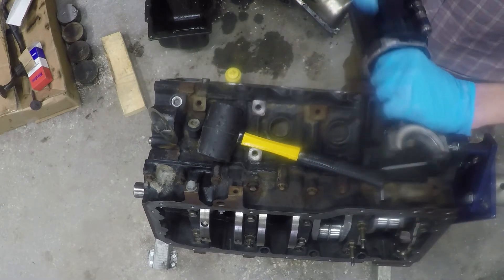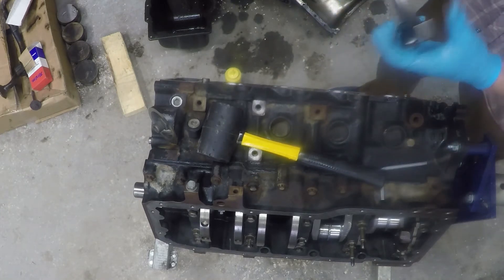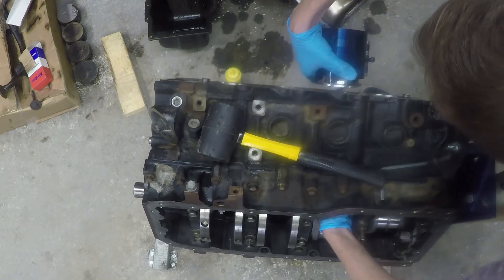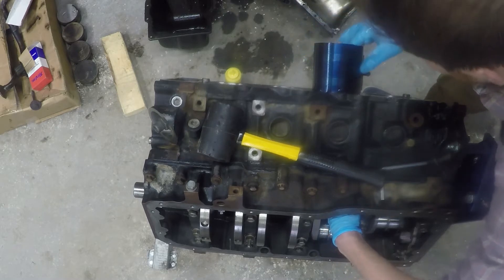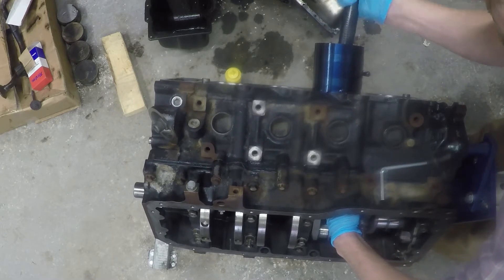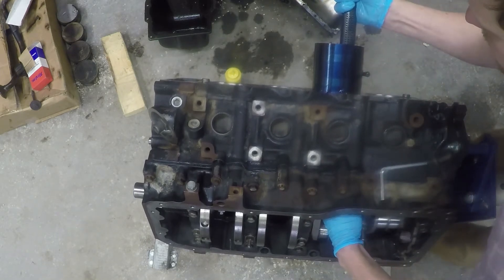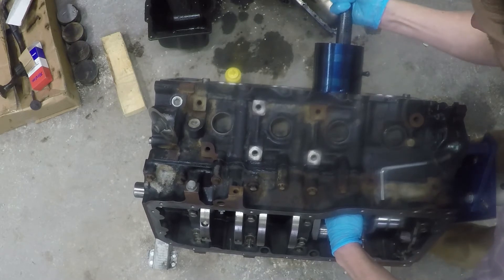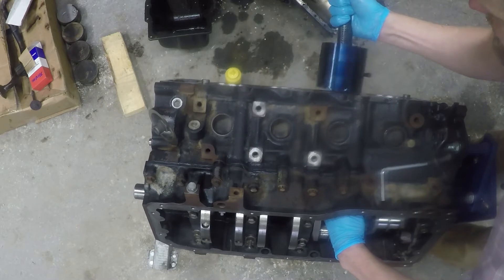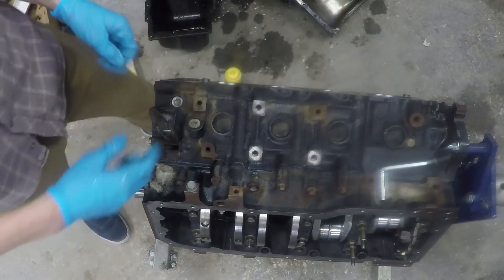It's probably better to do it here because you really don't want this scratching up your head surface. Make sure I'm facing the front. I'm going to put one hand in the back to catch that rod, and then I've got this one coming in from the front. I'm actually pulling ever so slightly on the rod as well, so that it doesn't push back up and allow that ring to slip out — just enough to keep pressure on it. Going real gently, not forcing anything — and there it goes. We got one in there.